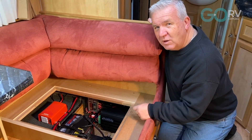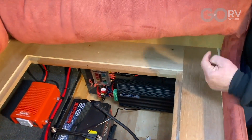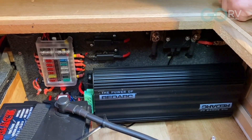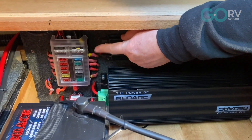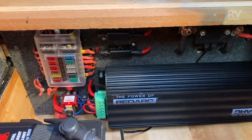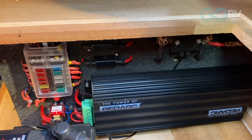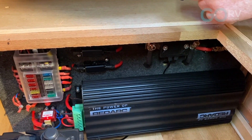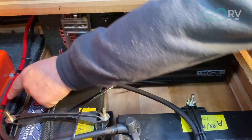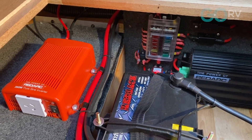With the board now back in, the job's done. You may remember previously we had a battery charger, a separate regulator, and a few other bits and pieces — that's now all been replaced with the battery management system. The fuse board is now in over here and we've added fuses, additional circuits, and better control over where all the lighting and power is being distributed. Below that is the load disconnect protecting the batteries should we drop the charge. The wiring on the batteries is really heavy cable and it's all been secured so nothing can move, positioned to handle the extreme movement when the van travels.